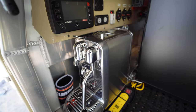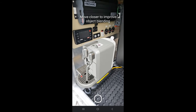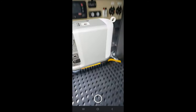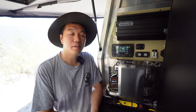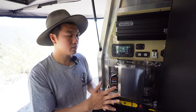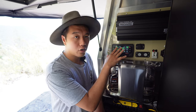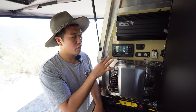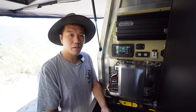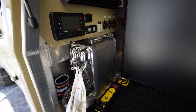10mm extra in any direction and this just wouldn't fit. Because of how tight this was going to be, what was really helpful was Nespresso's augmented reality app — you can pull it up on your phone and position the coffee machine virtually on your screen using your camera. In terms of wattage, all these mid-range machines vary between about 1200 and 2000 watts. But on my observation of the Redarc monitor, it doesn't really pull anything over 130 to 140 amps, so you might get away with a 1500-watt inverter, but I'd recommend 2000 watts just to be on the safe side. The machine is super easy to use and cleanup is really minimal.